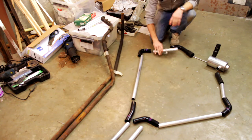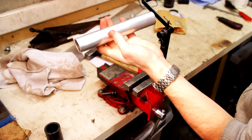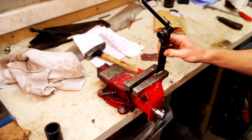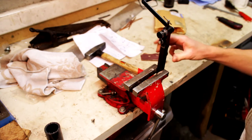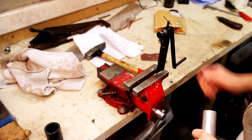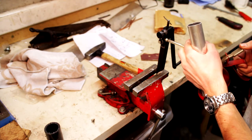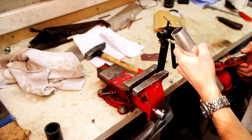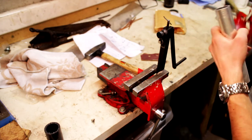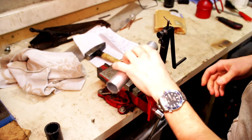What I'm going to do now is put a bead on the end of all the straight tubes. This is one of the shorter aluminium tubes, so it's easy to show you how to do this on a short tube. This is a tube beader that I bought off eBay — it's made by a guy in England and was relatively cheap. Let me quickly demonstrate how to use it. Take a little bit of oil and put it on the rollers, then insert the tube.